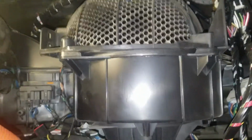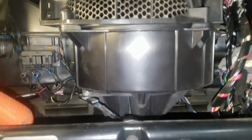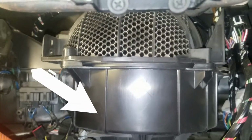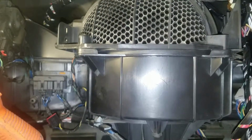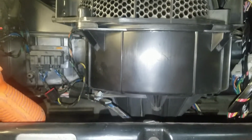Another way to get up in there and hold that door: if you look at the bottom, you can see where the fan motor is. There's 4 screws holding that in. A 5/16 inch socket will take that blower motor off. The screen part at the top is where it actually draws in fresh air, and the actual recirculate door is inside there. So for access, drop that motor off at the bottom.